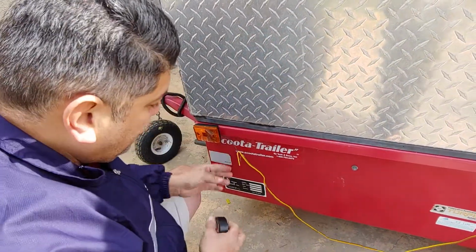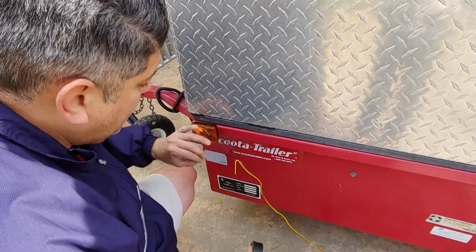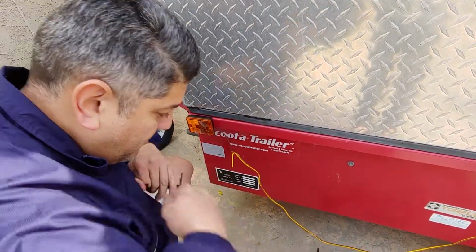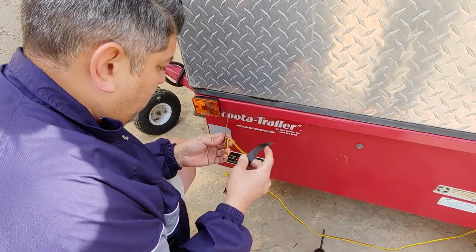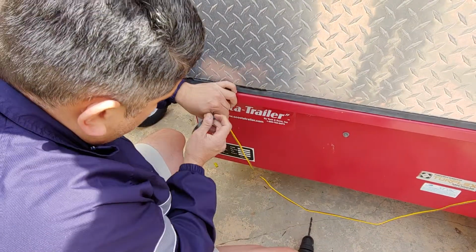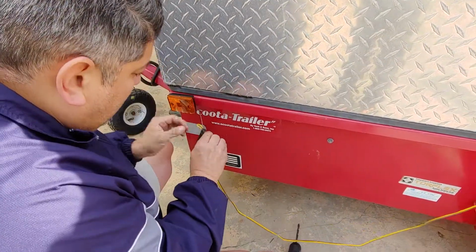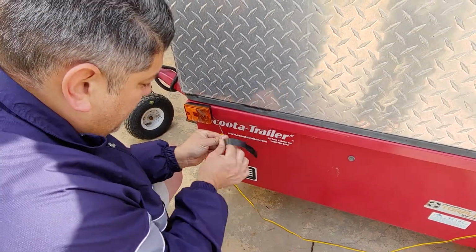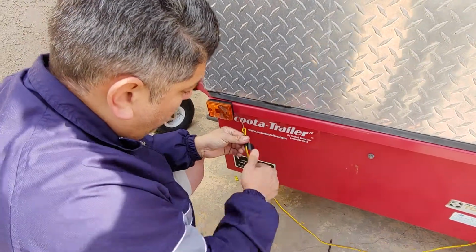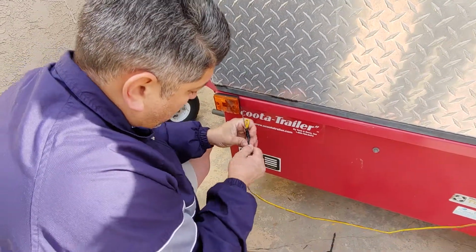And from that moment on, the new light is going to have the regular running lights, but whenever I'm blinking to turn, it's also going to blink to let them know that I'm going to change lanes or make a turn. So I'll go ahead and peel that one, and then we're going to again make a little turn like this so that we can give it some strength here, and it doesn't pull against it, and it protects it. By folding it that way, I limit the risk of a pull and separation from those wires. So I'm going to pull and make it nice and tight here.